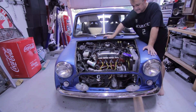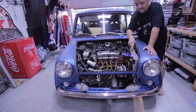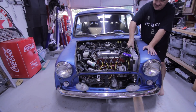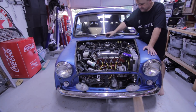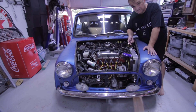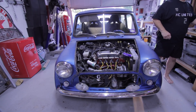So I'm going to say the oil is okay, and I'm going to say that the coolant is not leaking into the oil. Next, I checked the radiator. I just installed this radiator about a month and a half ago along with fixing the oil leak. I found yesterday that there was no visible coolant — I don't know if it's half full or completely empty. So what I'm going to do now is fill it and then do a pressure test.